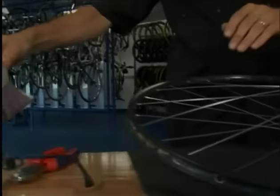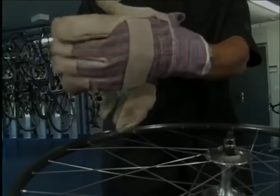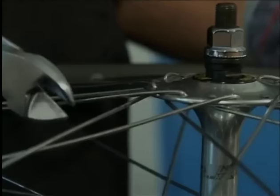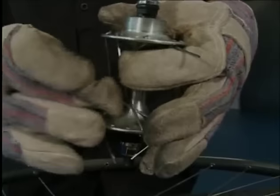We take off all the spokes near the hub with a spoke cutter. Caution, as soon as the work with the spoke cutter begins, it's important to wear protective gloves. Those who do not wear glasses must absolutely protect their eyes with safety goggles. We must be careful of the ends of the cut-off spokes, as they're as sharp as needles.